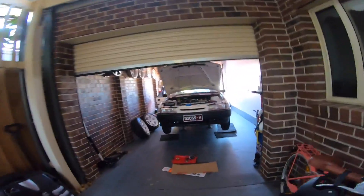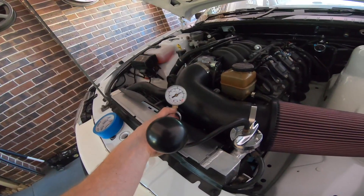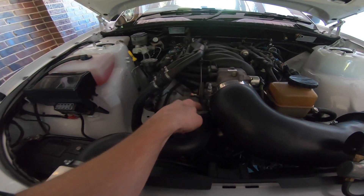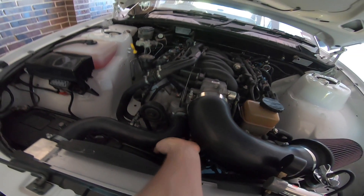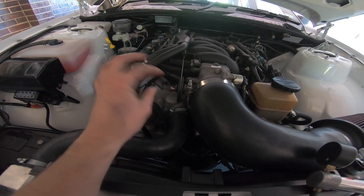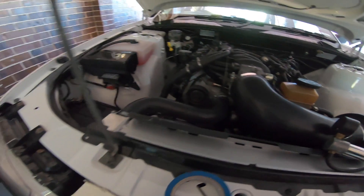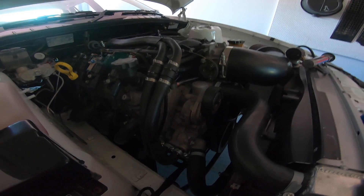Unfortunately I ran out of black paper. I've got a pressure tester so I can figure out where this leak is coming from. I thought it was the water pump, but it was actually the top radiator hose underneath — it wasn't done up tight enough. It felt tight but I just nipped it up and it stopped the leak. I'm not sure if the end of the hose is damaged; I might just put a new top hose on anyway. So don't have to change the water pump — good news.